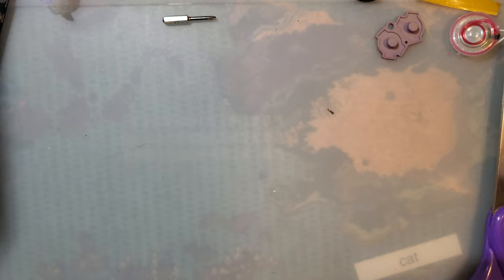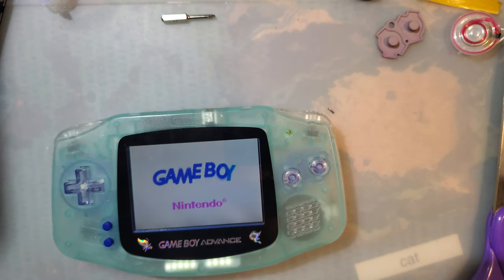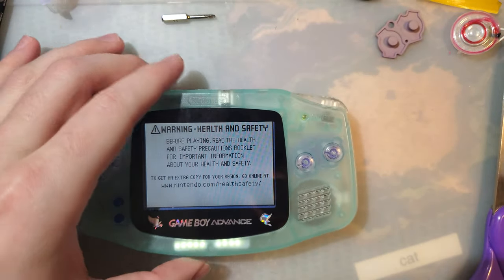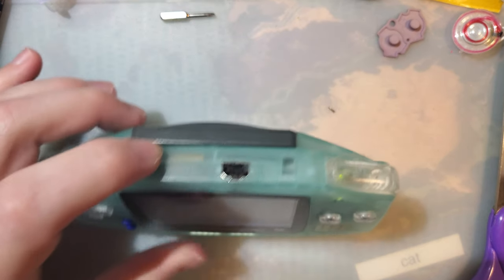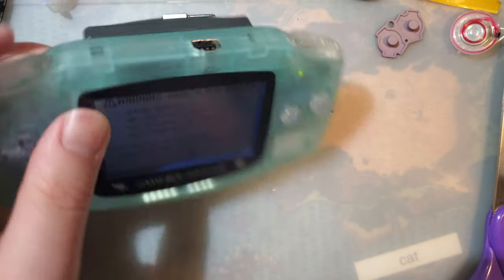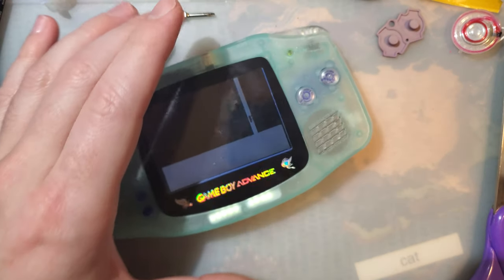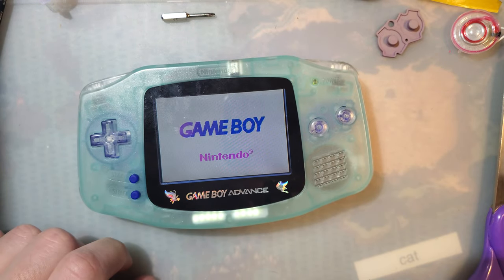All right, quick follow-up. I was going to put some notes in the description, but I know most of you won't read it anyway. So, I got the screen fixed. The problem is the ribbon cable adapter, because this is an old AGS-101 mod. There is a ribbon cable that goes from the console to the screen ribbon cable. I don't know if it's broken or what, but I ended up just shoving a bunch of foam in there, and then when I screwed it together, everything was working, and it's stable. But, you know, it seems to work fine.